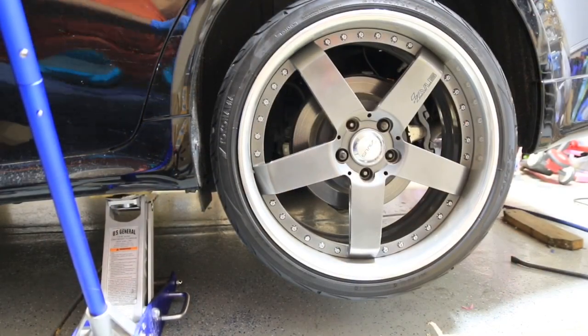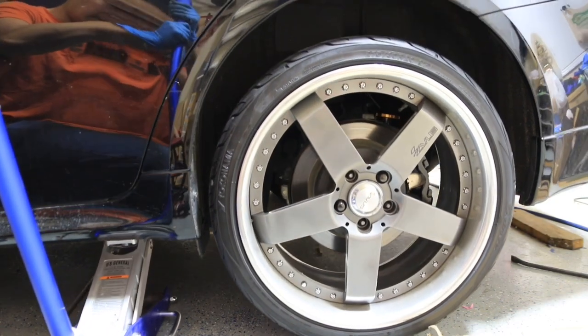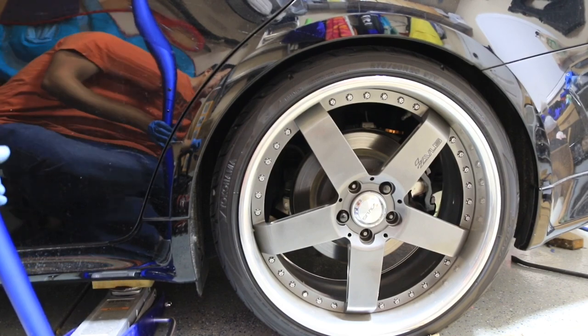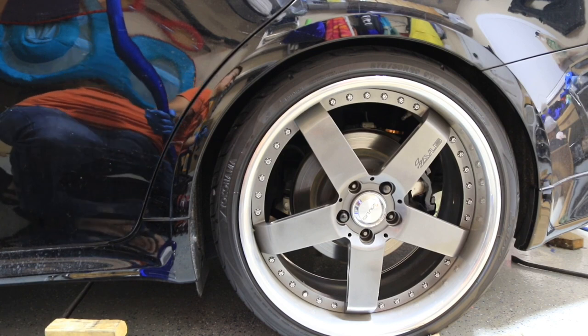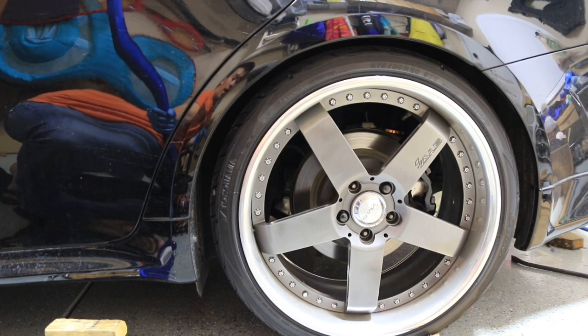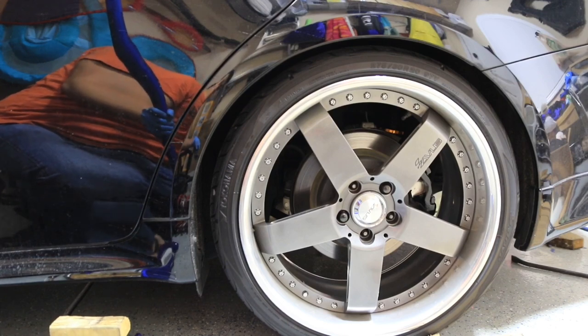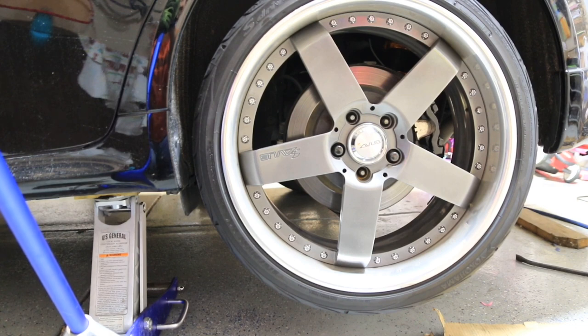So I've got it lowered. I'll see if my initial adjustments worked. Yep, so it looks like right now my car is actually higher than with the spring. So that means I can lower the spring down more up top. All right, so I adjusted the spring down about 3/4 of an inch. See how low I get now.